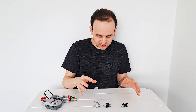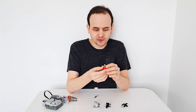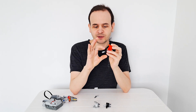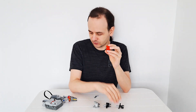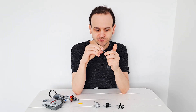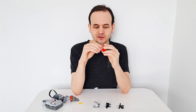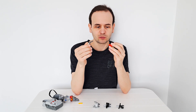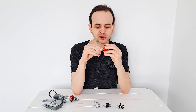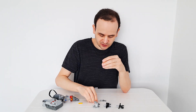The idea is: why not combine all the advantages of these three hubs and make my own? This is what I came up with. The attachment points for the suspension are the same as the first hub, so the suspension arms are only three studs apart. I'm using the normal CV joint — while it is a bit weak and has a limited steering angle, it is simple to use, nothing can go wrong, and it's reliable as long as you keep the torque low.